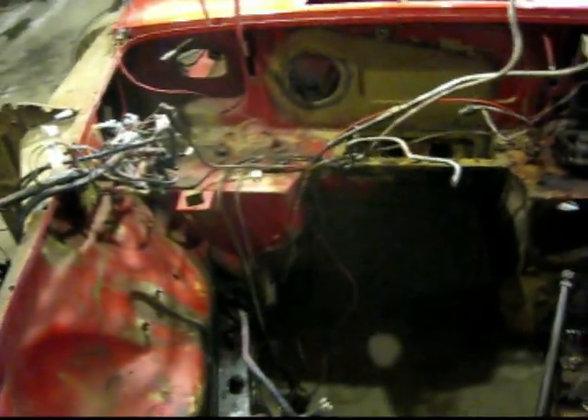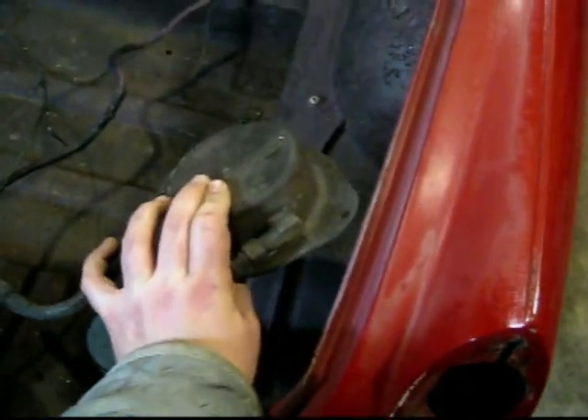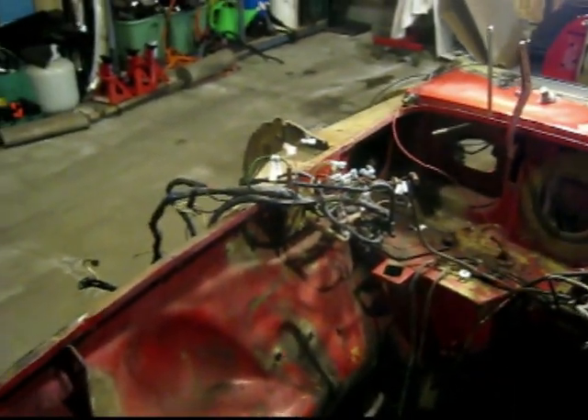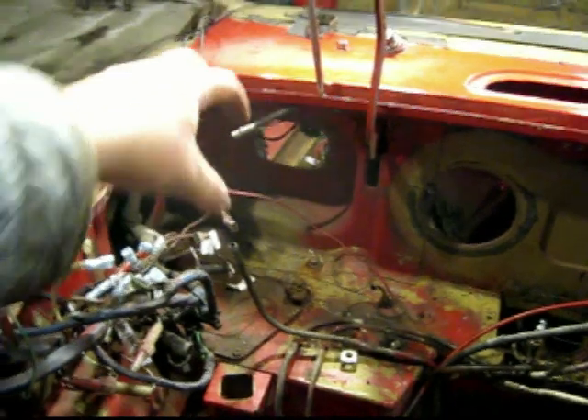Maybe I'll talk about all these lines going in a million different directions. Right here we've got the gas line, which goes underneath and down towards the rear into the gas tank. There's another one here — I think this comes from the overflow. This canister over here is where excess fuel overflows into if you fill your tank all the way up. Gas expands and needs somewhere to go or else you'd have an exploded gas tank. This would funnel fumes into the emissions canister.